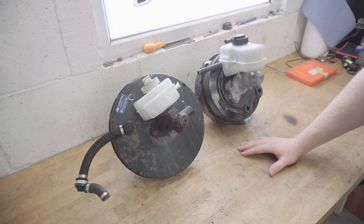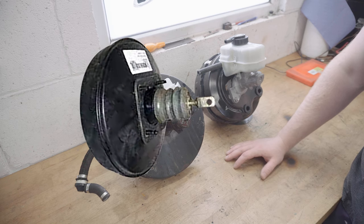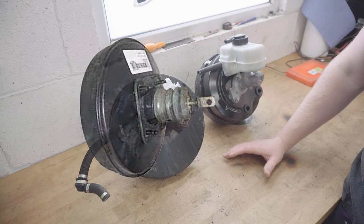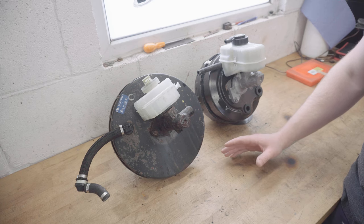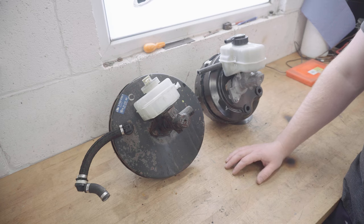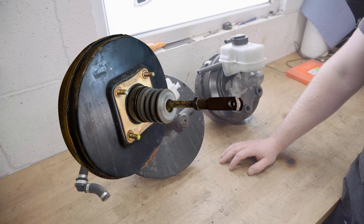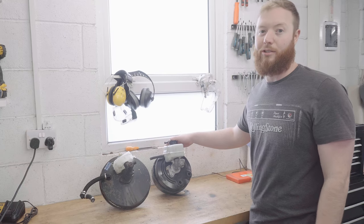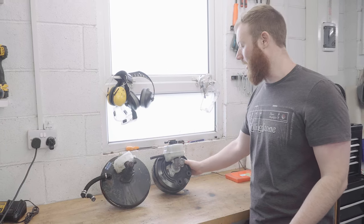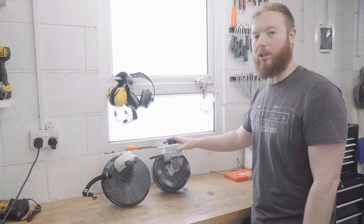Historically, the most popular solution in the UK is actually to use a very specific booster from a Renault Clio Mark II, 1.2 litre, 2001 to 2005. But these are now becoming much harder to find in good condition, and there's a particularly fiddly aspect with the length of the pushrod. People report a lot of inconsistencies in these boosters, including modification to the pushrod to get the length right, which sounded like a real pain. Another option I considered is the 944 booster, which is a more popular mod in the US where Clios don't exist, but these parts are very old now and again hard to get in good condition. To cut a long story short, each option comes with its own complications, but after quite a bit of research I did settle on the E90 booster as the optimal solution in this day and age.